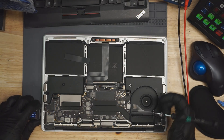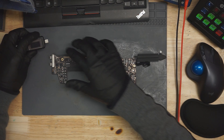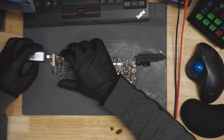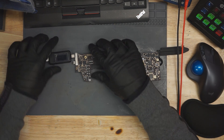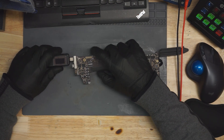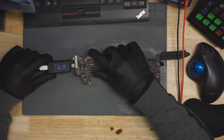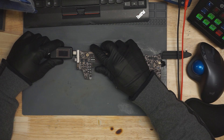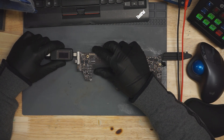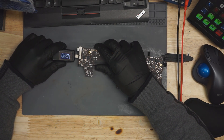Let's get this board out of this MacBook and see if we can fix it. The problem is it wasn't negotiating 20 volts with the charger. And when we plug in the charger now, it's not showing anything at all. Much sadness — one charging port doesn't work at all, and the other charging port is stuck at 5 volts.